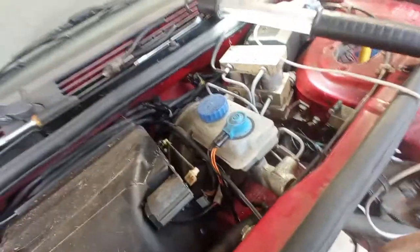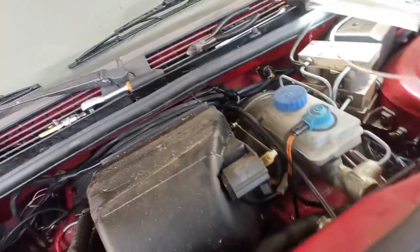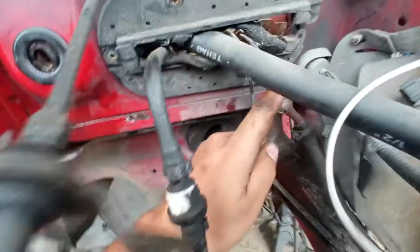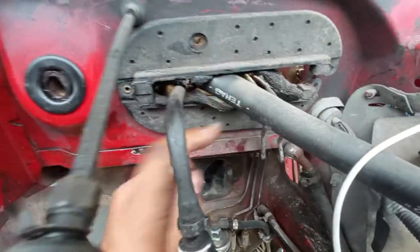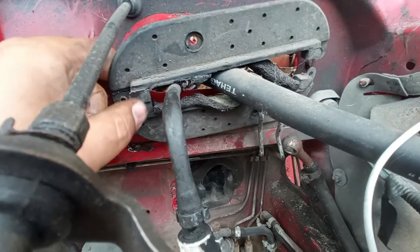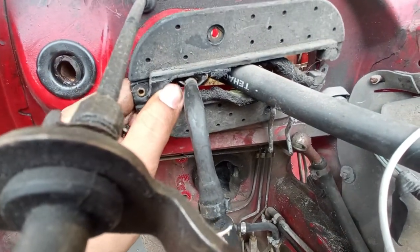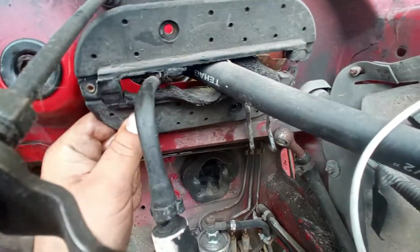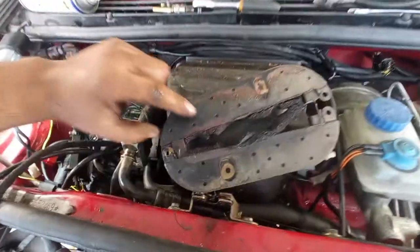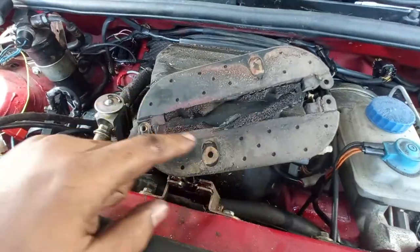This AC line, I can pull it. Just take out here the screws. We have four. One is missing over there. Okay, so one over here, another one over here, third one and fourth one over there. Now just take this out. It will separate in two if it wants to. Save it. Then we'll just clean it very well. Reapply here the foam.